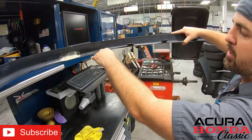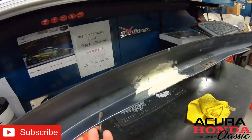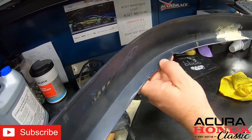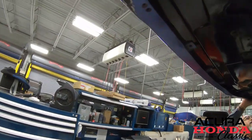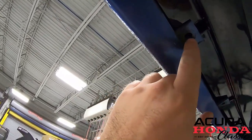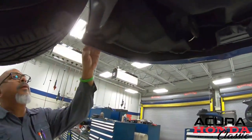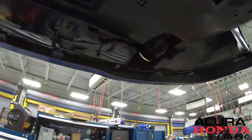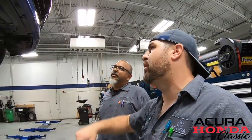Right now we have the lip in its original form. As you can see, it's got that little inward curve towards the middle and it's good to go. We already did our repair here, but we still have a crack over in this area which we'll show you. What we need to do now is test fit it. We're looking to see the plastic tabs mounting up with the bumper — we got one, two, three — and then the metal tabs that are currently off. It looks like she's going to mount up pretty good. We have a seamless gap line — I think it's going to look good. So it's strictly cosmetic from here.